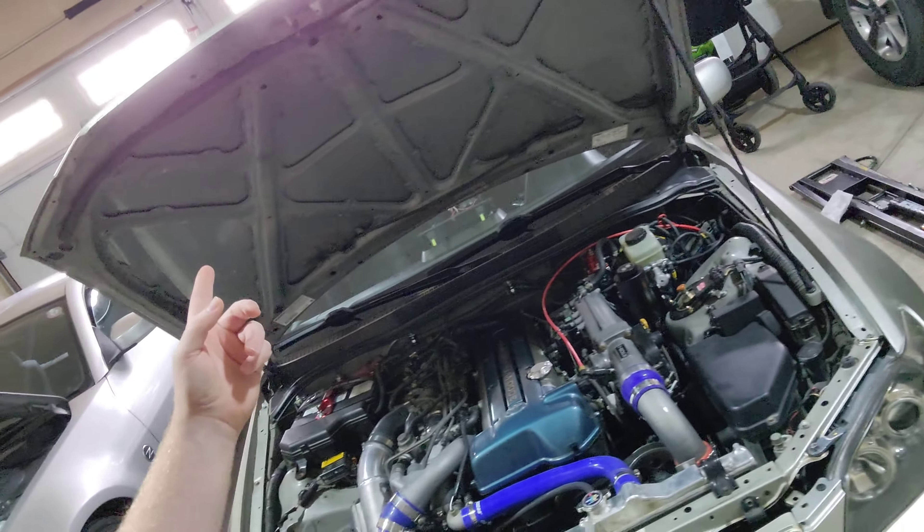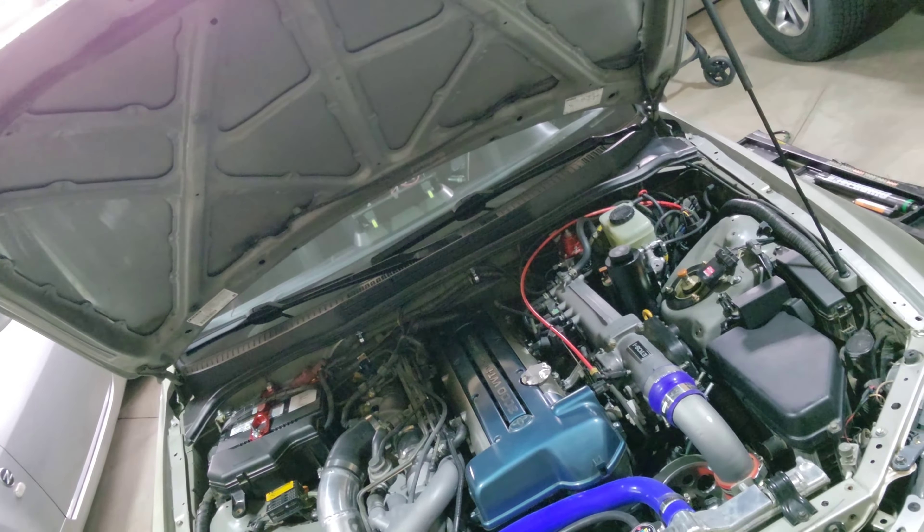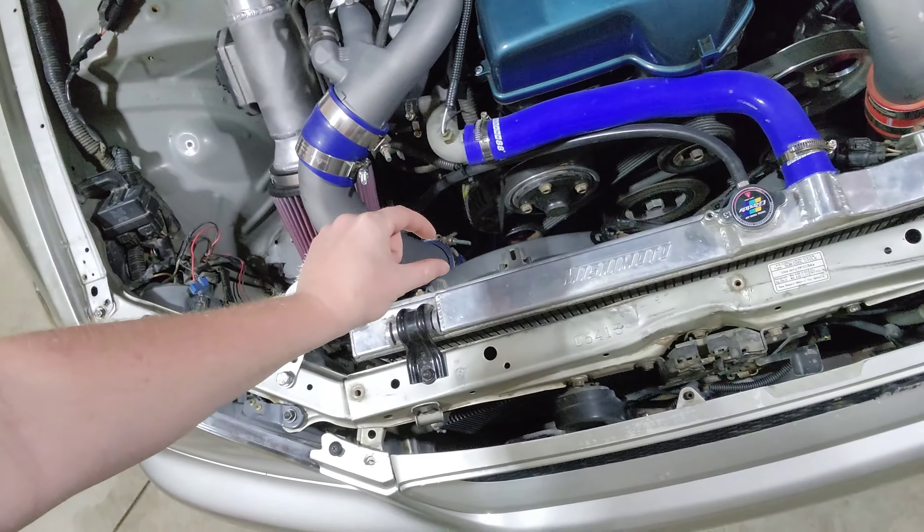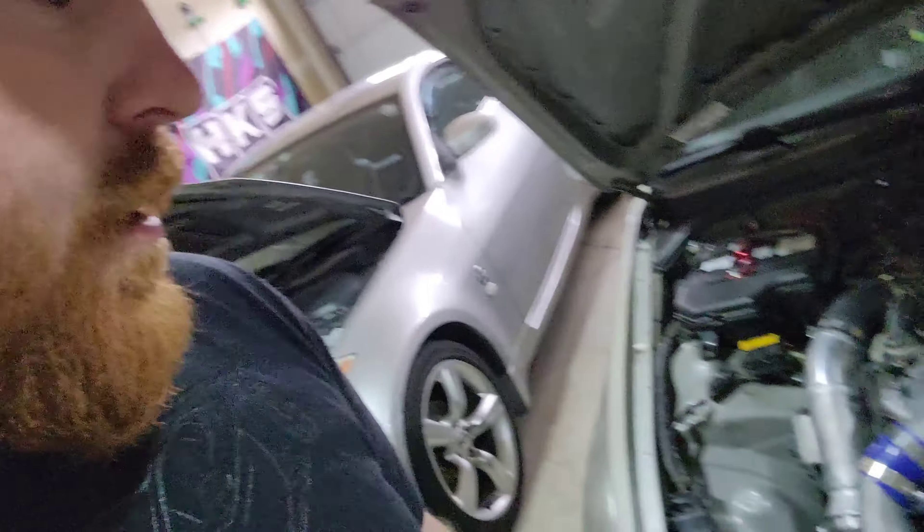The 215 while stationary — the hood insulator might be keeping hot air in. My fans might not be as good as the OEM ones, which they're probably not. They say that a stock 2JZ fan is the best fan. I do have my small SPAL fans in there, but I don't think they're pushing the same amount of air. Also debris in the radiator — I blew out a bunch yesterday but didn't get all of it because I don't have the right tool. I actually do have the right tool but it's leaking air. I'll have to figure out an alternative for that, but we're making progress — and that's what counts.